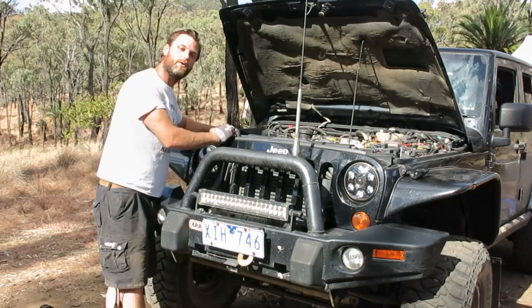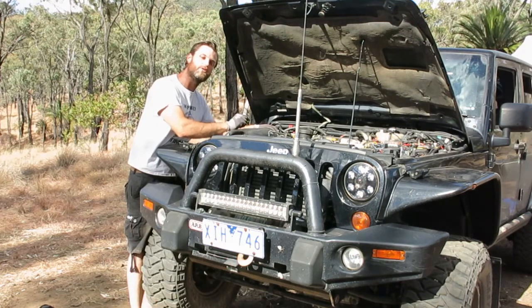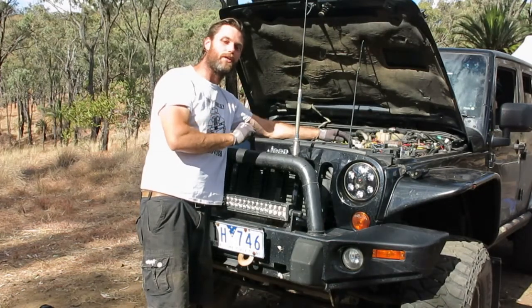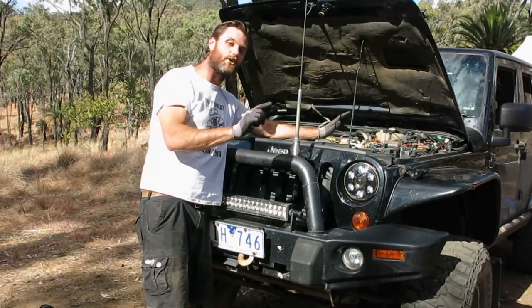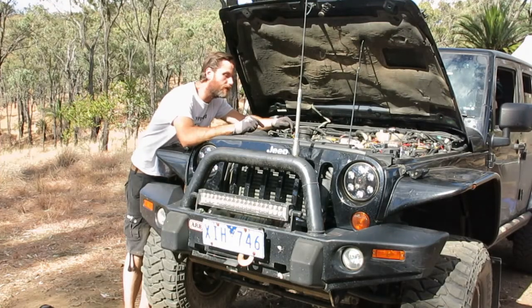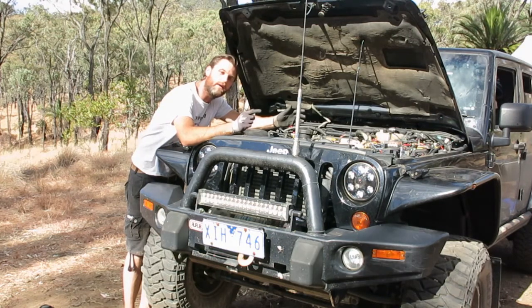Check your steering fluid level. Of course, check your brake and clutch fluid. Make sure it's between the lines specified on the side of the jar. And don't miss your wiper fluid. It's really annoying when you've got dust on the windshield and you can't get it off. Do a visual inspection of your belts. You're looking for any frayed parts, any worn parts, or any suspect looking areas.